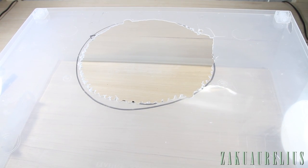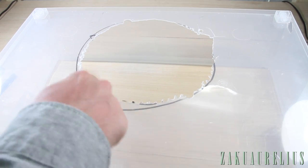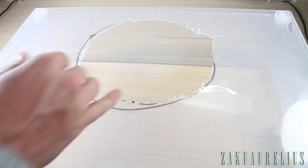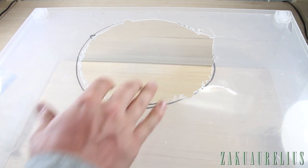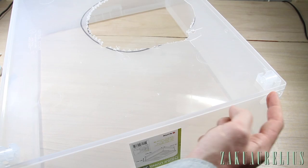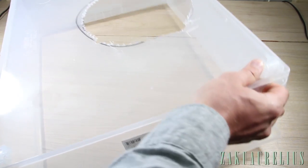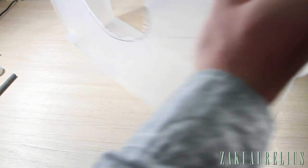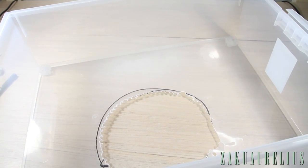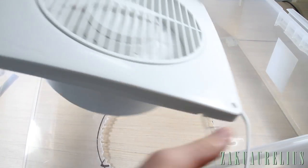Well, finally, what I did was just use my power drill and drilled the holes all around there and punched it out and did some extra drilling, adjusting there. And then I drilled a hole in the side here for the cord to come out. And then a couple holes here on the bottom. You can see that. And then on the front. So our fan can go in.